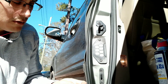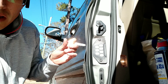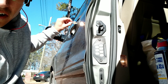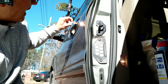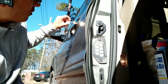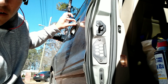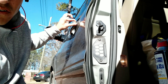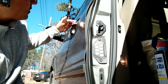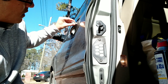What I want to show you now is the importance of knowing which side of the key to start on. The way you determine this is by first inserting the key all the way in, pulling the red metal slider out slightly — not all the way because it's going to slide all the way out — just slightly out, and then grabbing the key and seeing if it comes out. If it doesn't come out, this is your starting point. This is where you're going to read your first pin.